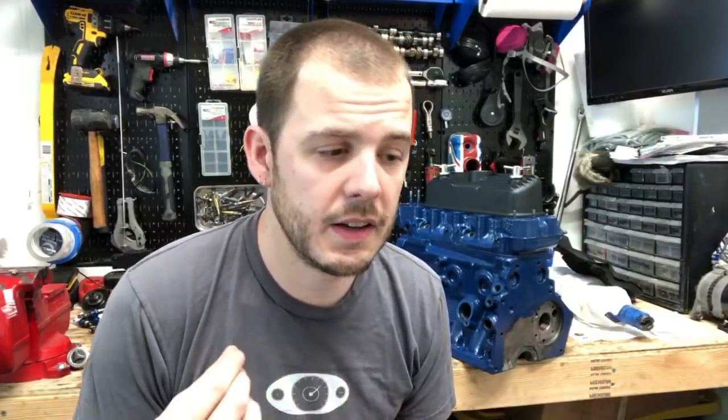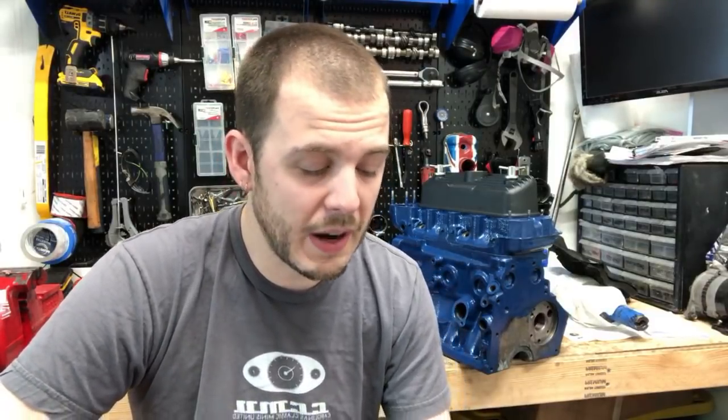So there are two steadies, especially if you have a rod change gearbox, they have lower steadies that are built in by the factory. And the factory ones, like Dave said, break. They break a lot. They almost always break. And there are replacement versions that are stronger steel that use basically the same dog bone mount that's used on the top, on the bottom. And you can mount them both on the bottom sides of the rear of the gearbox. So check those. Replace them with poly if you find them, and I just go ahead and replace probably the whole bracket.